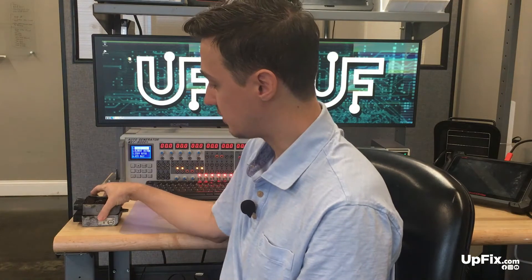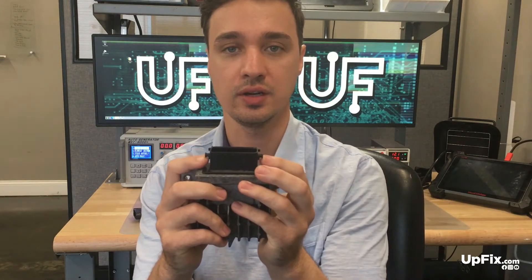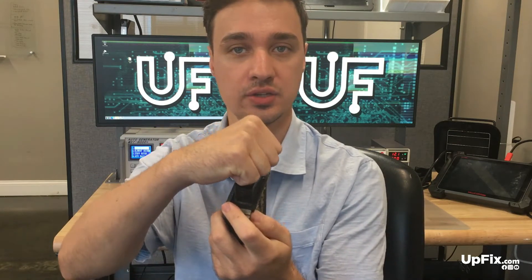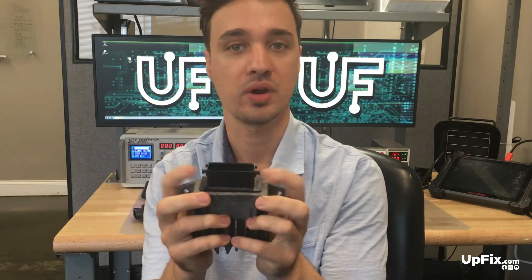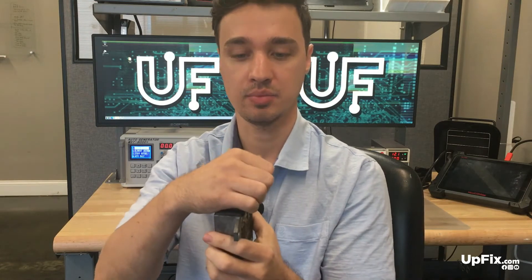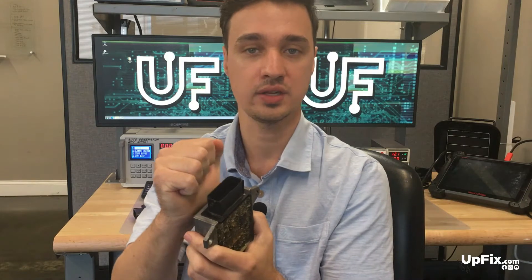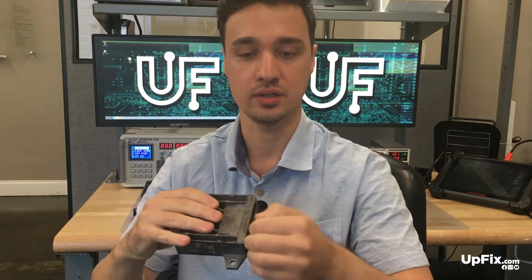Another important factor to keep in mind is when you're removing the locking mechanism on the plug — you've got these two little ears on the sides. A lot of times what happens is the clip is not fully disengaged, the locking mechanism, and when you try to pry out that plug, it'll actually break these connectors. One of the downsides of having one of these tabs broken off is that when you try to secure that plug on top, it'll eventually slide off. So make sure the clip is fully disengaging, and the plug will simultaneously start moving out — there'll be a white connector on the top.